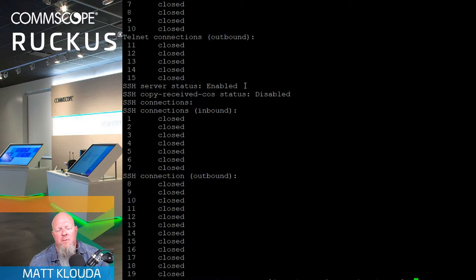So my first question for you with that is, do you have a physical hardware SG1100 or other model of NetGate pfSense, or are you doing it in VMware? Because that's going to matter, because you also have to configure your VLANs in pfSense. And I do this at home. I have friends that do this at home, and it's a little involved. And full disclosure, whoever wrote the switching software in pfSense did not consult with a switching expert when they wrote that. It's very, very confusing.